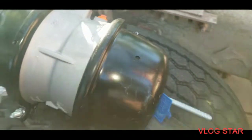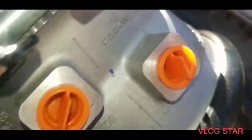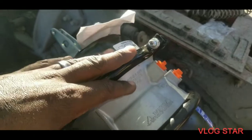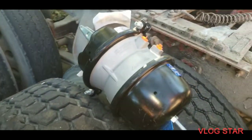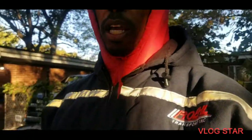Right here we got the new brake chamber. We also got our new cotter pin and our pin to lock it on down. Got fresh new bolts on there — go ahead and slap this thing on. You got your service side and your parking side — you gotta make sure that's correct when you do it. If it's not lined up correctly, you will have to clock this thing. Y'all that work with chambers know what I'm talking about. Gotta make sure that pancake is sitting on there right — if not, you will have a leak.